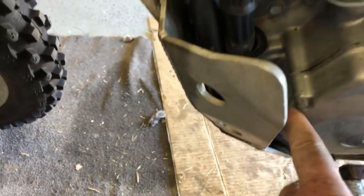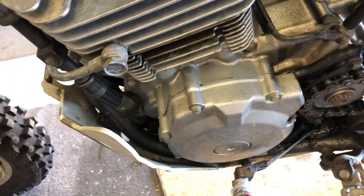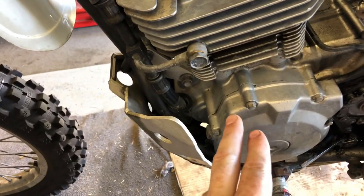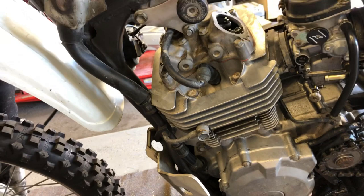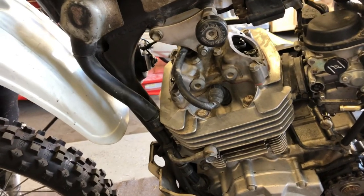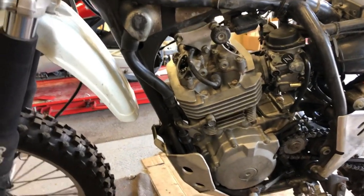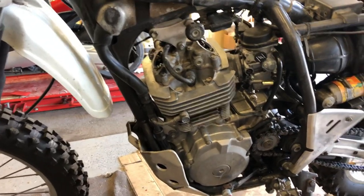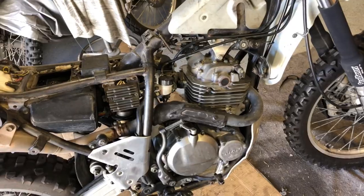You remove that cover to turn the engine, and then there's a cover under here — you can't see it very well because of the skid plate — but inside of there you can see the little mark for top dead center. I think I have another video — hopefully I'll remember to link it — where we worked on the top end of this engine. I'll get to top dead center and then adjust these valves. He said this came on kind of suddenly, so I don't have a good feeling that's going to fix it, but maybe it'll fix the noise.